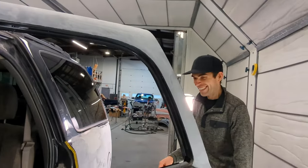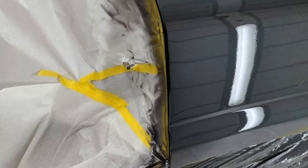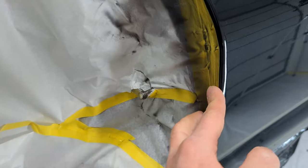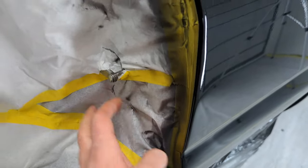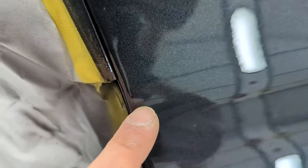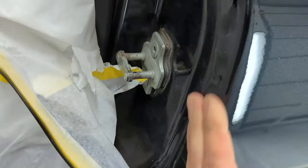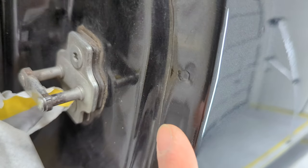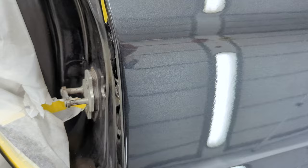That has been advanced masking strategies with Aaron. Here's the other side of the soft edge mask trick. After that first piece of tape is put on, the paper goes into the door jam and then the weather strip — all that stops the overspray from going into the interior. Once you unmask it, you've painted your adjacent panel, the fresh paint comes over and it doesn't go underneath that tape all the way. So once you do it back, you just have a really nice soft edge where you don't really see any sort of line. It works really well. Anyways, hope that helps.